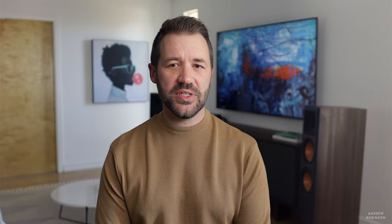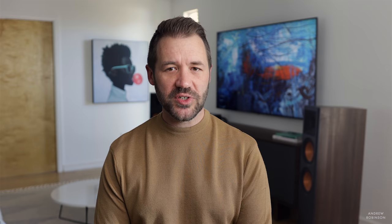With these settings, contrast is pretty impressive — good enough that I'm happy leaving well enough alone. If you want a brighter image, you can push the Movie mode's brightness up to around 500 nits, but doing so will skew grayscale accuracy and cost you some contrast. Increasing brightness to full causes blacks to crush and highlights to bleed. If it were me, I'd set it to Movie mode, switch the color tone to Warm 1, and just walk away. Because of the edge-lit design, there's no real blooming in any of my test patterns — the Q70T looked very OLED-like.